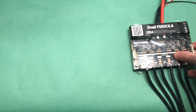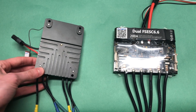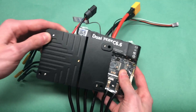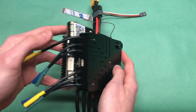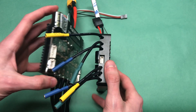This ESC is very compact as we mentioned before. Compared to the FlipSky Dual 6.6, probably its closest direct competitor, it's a lot smaller in terms of width but actually a little bit longer in terms of length. This is bad because you'll need a longer enclosure, but good because it takes up less space inside your enclosure. The thickness on both is also pretty much the same. The only thing that separates the Bound Motor one is that it comes with an aluminum case whereas the 6.6 comes with nothing.